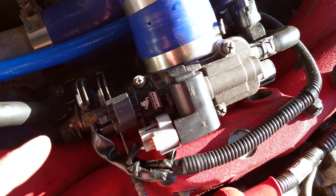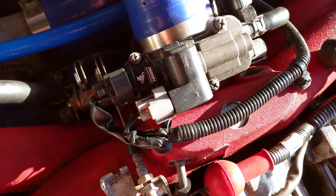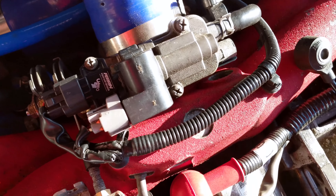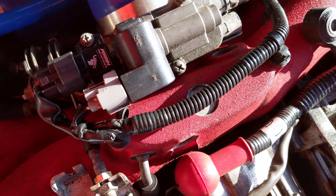Unless you can adjust your ECU yourself to linearise this, because if you get that wrong, your car won't know how much boost to get, then you can run lean, and you've ruined everything before you've even got anywhere near the dyno.